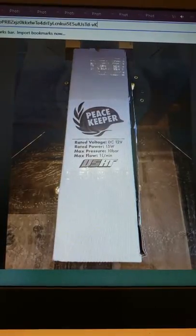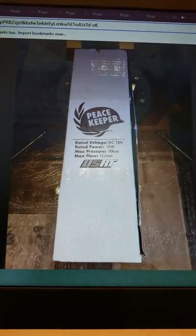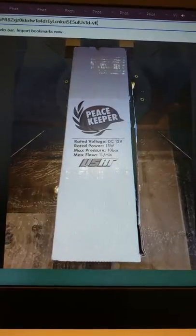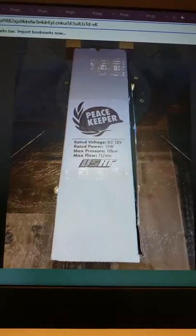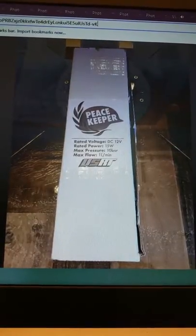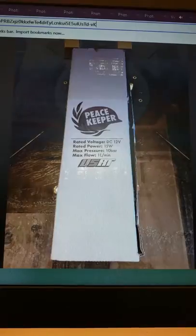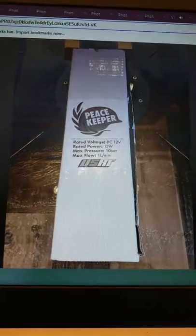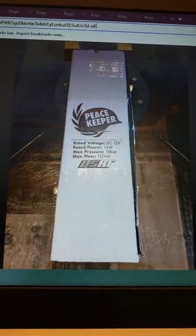As the system triggers, the pump kicks on and starts spraying at around 75 to 100 psi through as many nozzles as you want to place in the car. That fluid transfers to the intercooler or radiator and cools it down over time as air rushes in over the surface of a wet intercooler. Unlike water-methanol injection, the kit cools the intercooler via evaporation from the outside to eliminate heat soak — basically eliminating heat buildup over time due to the time it takes to evaporate the liquid sprayed on the intercooler.